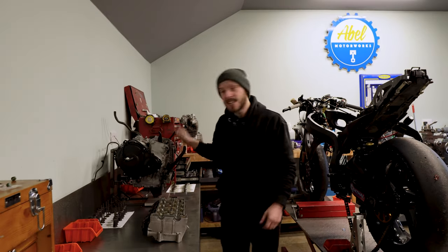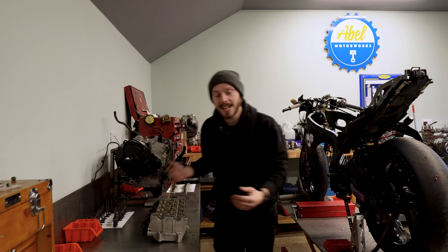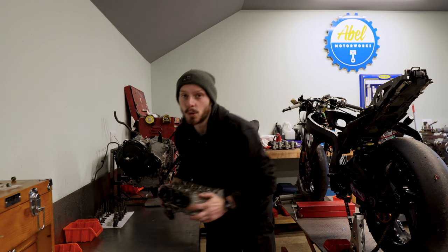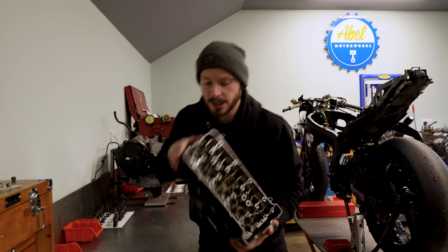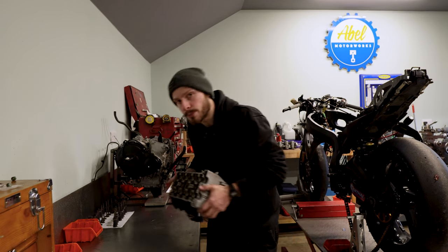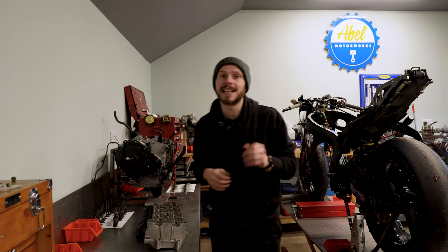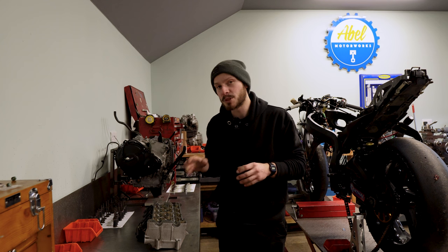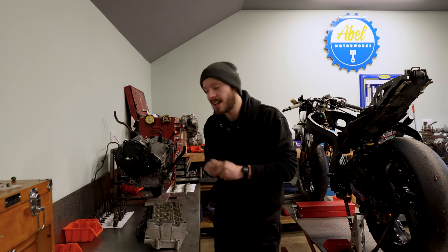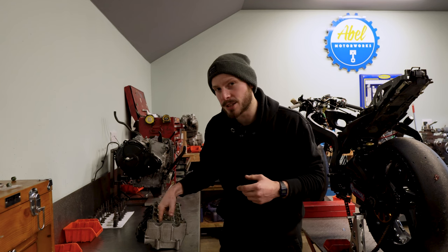So that escalated quickly. This engine has come out of this bike that was originally only here for a valve clearance check. It had a dyno run that showed a drop in horsepower, so it got booked in to check the valve clearances. Before we checked the cylinder leakage or did a compression test, we found that once the clearances were set correctly it still had cylinder leakage — some sort of issue internally with the head causing it to drop power. With the leakage test we could see it was leaking through the exhaust valves.